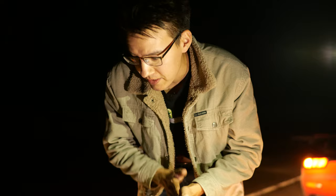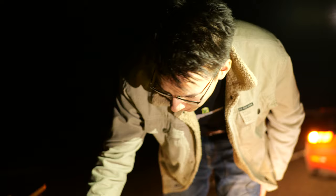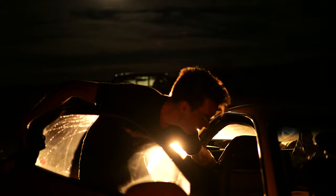Oh, crap. I was just driving along and I started hearing a hissing sound. And I looked up and I saw mist, water vapor coming out of my hood. And it was this line had disconnected right here. Just venting coolant. And I saw my temp start to go up, so I turned it off. But luckily it's not anything severe, just something rattled off.